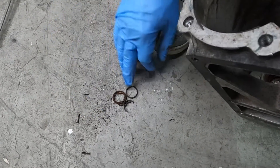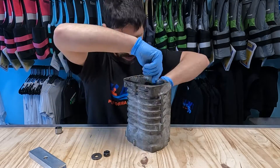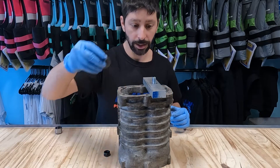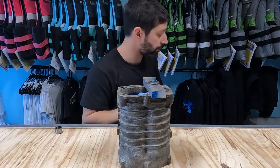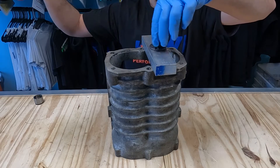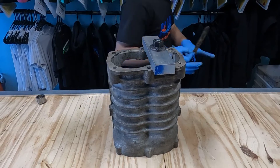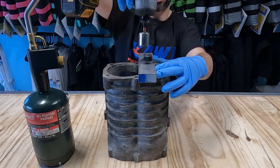Okay, looks like we got everything out — here's everything we got out plus the needles. Here's our tool; remember we've got to expand it in the hole. Okay, feels pretty good. Here's our block of aluminum right on top, here's our washer, and now add a little oil or grease to the thread. You could either do this by hand or use an impact driver. For those of you who are nervous about damaging anything, do it by hand for your first try. We're going to use a 19mm socket for this nut.